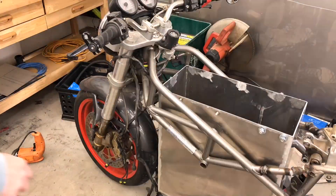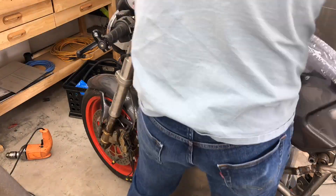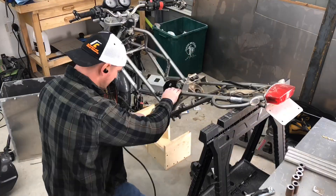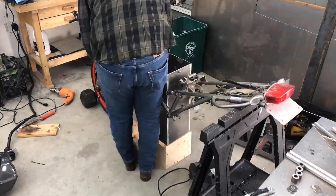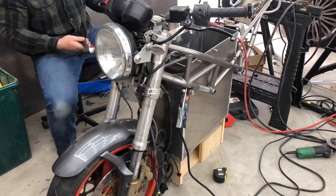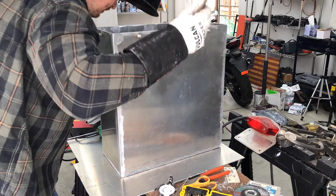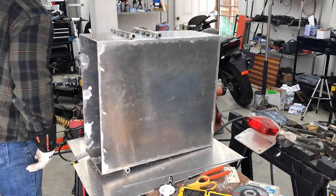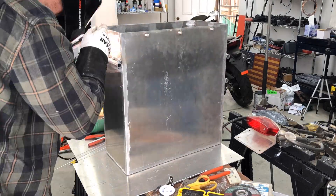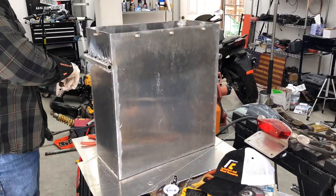I was really limited on all sides for battery case placement — too far forward and I crash into the suspension compression, too far back and I hit the rear suspension stabilization rod, too far up and I run into the tank, too far down and I don't have enough ground clearance. Once I had it in the right spot I just tacked those tubes right there and finished the welding when I pulled it off, making sure everything lined up so the rods could be inserted without binding.